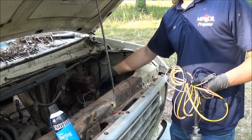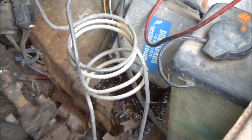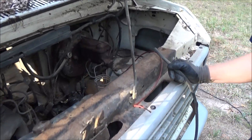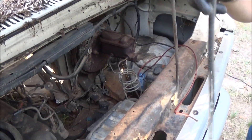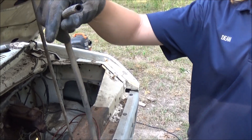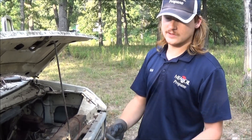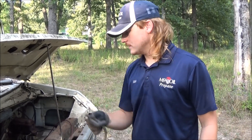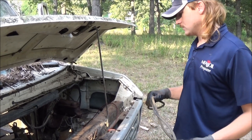It's pretty exciting — it has spark. I was a little concerned about the DuraSpark thing because it has all that goo leaking out of it, but apparently it still works. I guess it just got really hot at one time. Now what I'm going to do is try and see if this original fuel pump will work without rigging up that electric pump. We stole some washer fluid hose off of that truck over there — I know it's not made for it but remember this is temporary. We're going to hook that into the fuel pump and run it into my gas can, and we'll see if it starts picking up fuel.